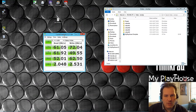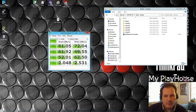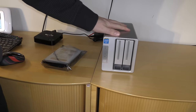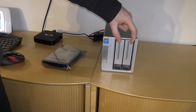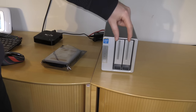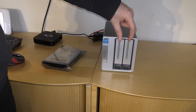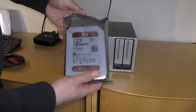I ran the test again against the Terramaster and the result is about the same. It's pretty good results for two solid state drives - I just don't understand why some numbers show ordinary hard disks performing better. One of the things that could be slowing this down is that the box has to make a mirror onto two drives. Usually RAID 1 gives better performance on reads, but it might not be a good thing with two solid state drives.